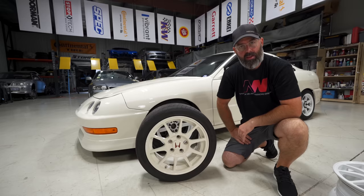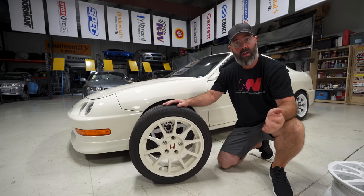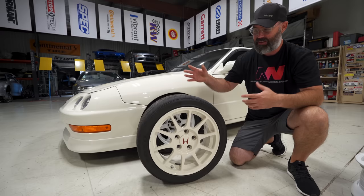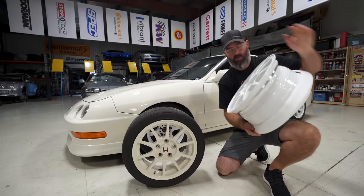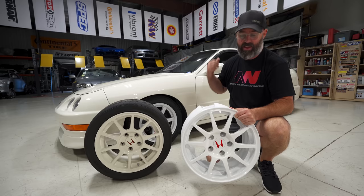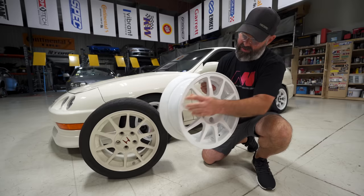Now that the EK is finally ready, we have a couple of things planned for the Type R just to sexy it up a bit. One of the upgrades we'd planned to reveal during the Valvoline sponsored series was to take this 16-inch JDM Type R wheel but downsize it to a 15 for better tire choice — you can't get good performance tires in 16s these days. We went to Augment Wheel Company, who we'd used before for custom wheels, and said, 'Can you make us something that looks like these but in a 15x7 plus 35 offset?' We wanted the fender clearance, to remove the camber from the rear, eliminate the understeer, and have a super sexy unique wheel. He said, 'Of course — and why don't I make them out of magnesium?' You can see it says magnesium on the wheel, and from holding it, it is insanely light.